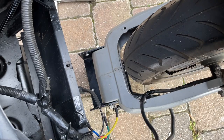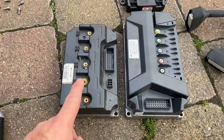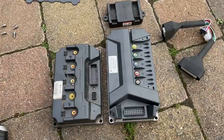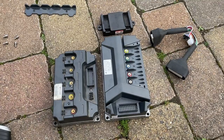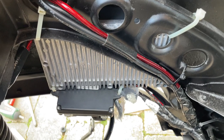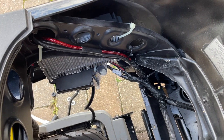I've got the bracket bolted back onto the new swing arm, but before I bolt it back up to the Vespa, I want to just do the controller. I've already disconnected the old one. You can see the difference - this is the old controller, this is the eScoot Parts performance controller. There's also this interface which I have to connect. This should fit in roughly the same spot without a problem. Instead of using zip ties this time, I will try to do something a little bit more permanent. The new controller is now mounted. I did end up using cable ties again, mainly because it is a bit of a tight fit, but hopefully this all works. In the future I might end up moving the controller down here - that was my original mounting spot, but I ended up using this dead space between the body and the frame.